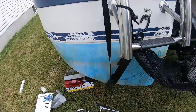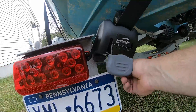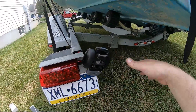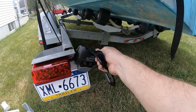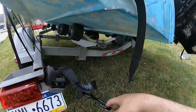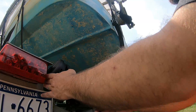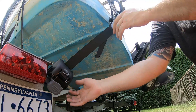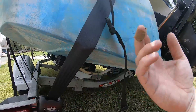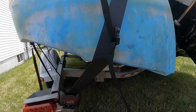Basically, here's how these work: everything is snapped in. You push on the release lever and that unlocks it, then undo it at the boat and it buckles back up like a seat belt. To get it back on: press release, pull it back out, snap it back up. Two-handed demo — release, pull it up, get it in the hook, release again to snap it back down. Pull up on the lever, hook and snap — tight. I caught the corner once but just release, adjust, and boom, good to go, nice and tight.